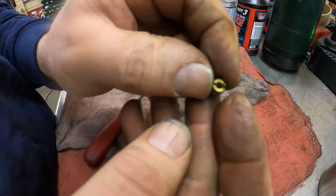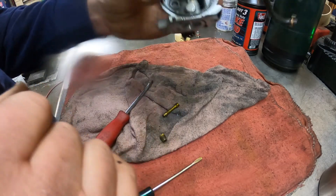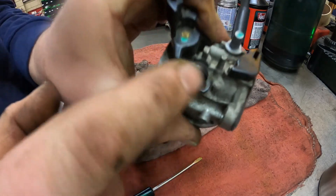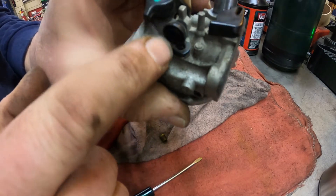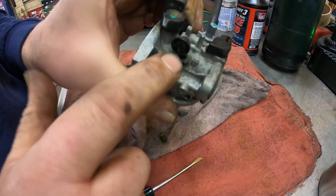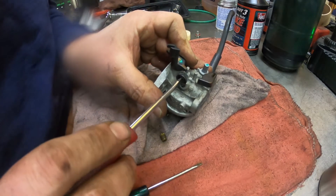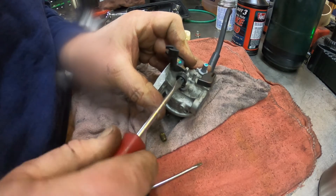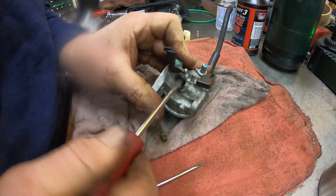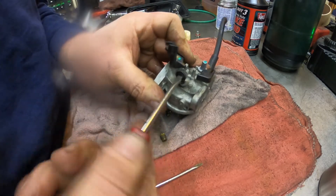I have a torch tip cleaning tool to clean these out — I don't think I'll need to soak this carburetor. One more thing: I'm going to pull this idle stop screw out, count the turns, and then pop this jet out because if this jet's clogged the idle will surge. I'll run it all the way in and count: one turn, two, two and a half, three, three and a half, four — it's roughly four turns out. Now I'll unscrew it all the way.